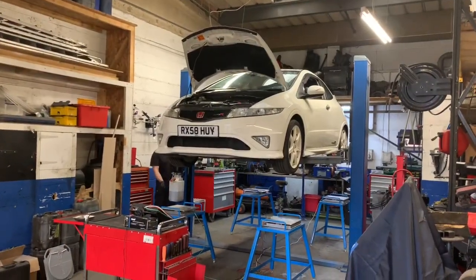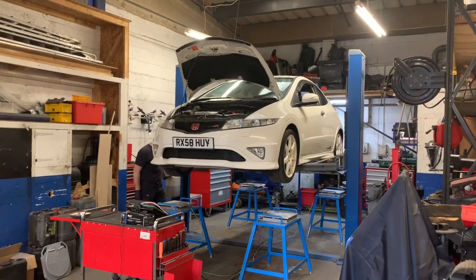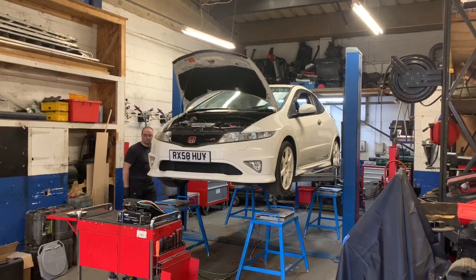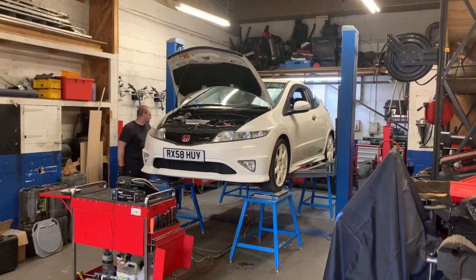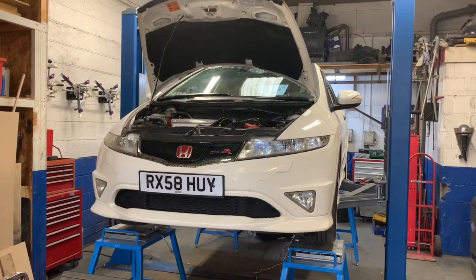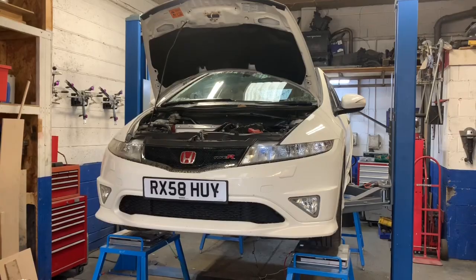So what Andy's been busy beavering away at in the rear of the car is adjusting the suspension at the back to bring the weight over to the front to one side. So that's very interesting and not what I expected. So he's bringing it back down onto the weighing plates, and we'll have a look and see what's happened. Okay, so as it was just explained to me, we have got it within 10 kilos on the front axle balance. So we're going again to do a bit more adjustments, see if we can get it a bit closer.